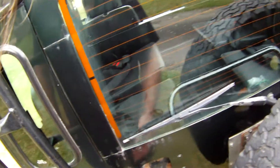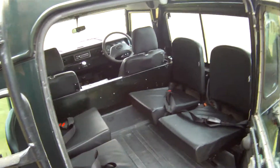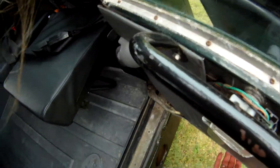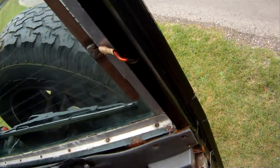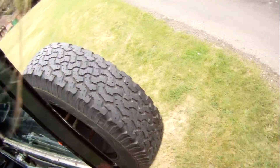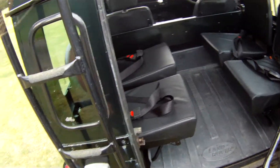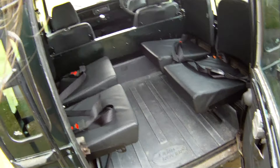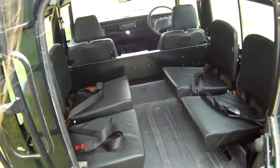The tailgate's got the usual electrolytic reaction. In the back it's all nice and it's got a load liner. The cover for the wiper motor is missing. The tailgate frame has been taped up around there and I can feel a hole — the tailgate is probably the worst part of it, as is often the case. The rear crossmember has been plated, and it looks like a quite good job. We're going to be supplying it with 12 months MOT, and if it needs any major work, that'll be done as part of that.